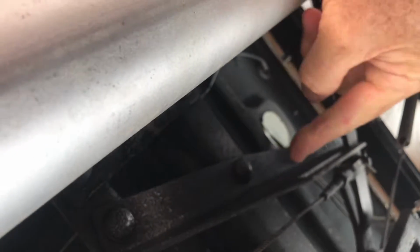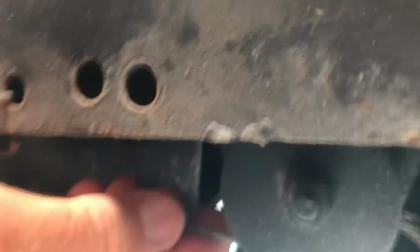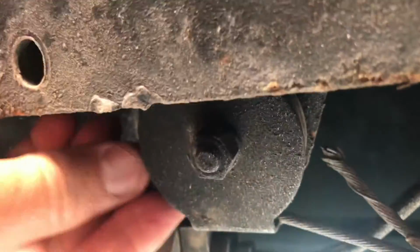We've got the emergency brake cables coming out of the back of the axle, coming up to this splitter. When the cable from the front pulls tight, this slides forward, pulling tension on these guys. This is a spring to retain tension on the whole thing. The cable goes up. It's got a little wheel right here, which doesn't really line up with anything. It goes through the frame to this piece, which hooks on the bottom of that lever that we just installed.